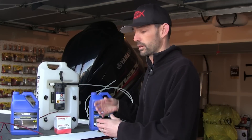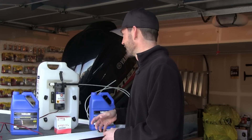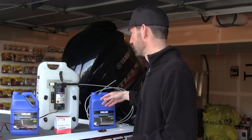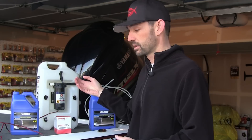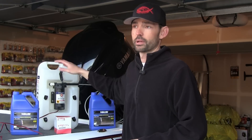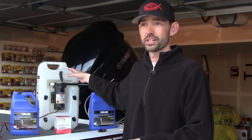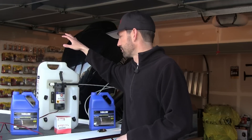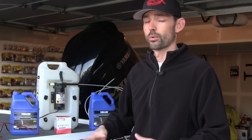When it comes to changing your oil, regardless if you're having a making-oil issue or not, you really only need a few things. I've changed oil since I was like 12 years old. You're going to need an electric pump if you choose to go this route. If you stick this tube down the oil dipstick, you can actually suck the oil out of the crankcase and not have to take off the side apron on the motor or use the drain screw — it gets messy that way. I elected to buy an electric pump. It's a lot cleaner, no mess. This was particularly kind of expensive — about $140 from West Marine — but I like the fact that it has a container I can keep safe away from the kids, out of the environment, off the grass and out of our water systems.